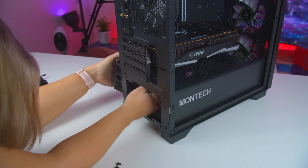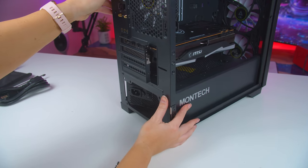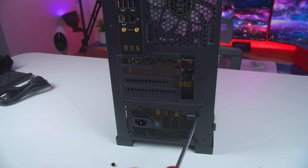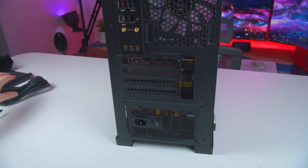Well, it's going that way. Okay. The thing is, if you have it the other way, it pulls in hot air from inside the case, so it's not good for the power supply. Look at that. One thing you are doing right is you're doing opposite corners, which is good. My dad taught me that one. All right, voila. Power supply is installed.